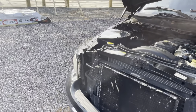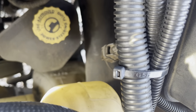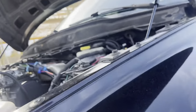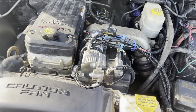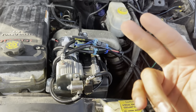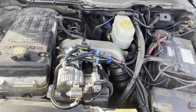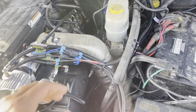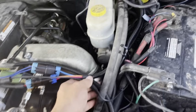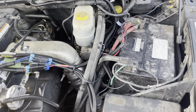Working our way into the engine bay — this is going to be the air compressor, and his tank is down under the front bumper. That is all of his stuff for running the exhaust brake. The compressor kicks on, fills the tank up, he flicks the switch in his cab, and the valve opens and closes based on the RPMs of the truck. It's wired into the ECM, so when you let off the throttle, it kicks the exhaust brake on when you want it.